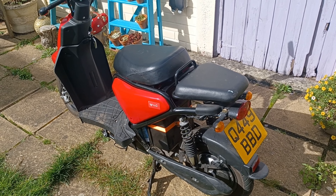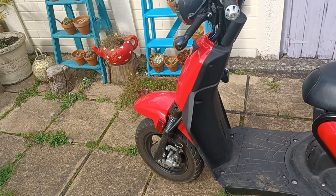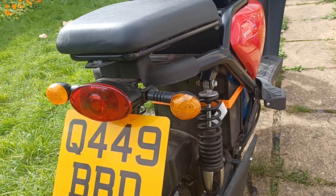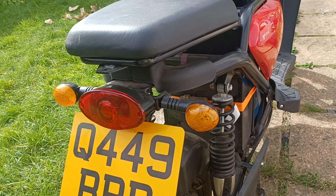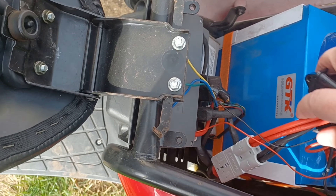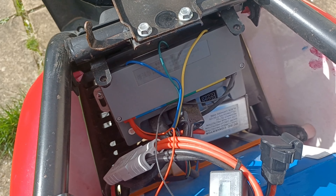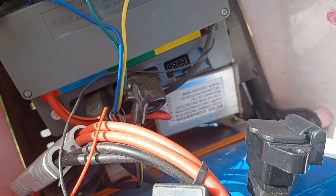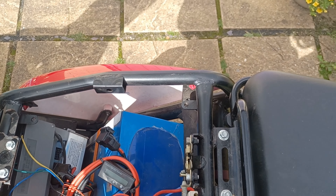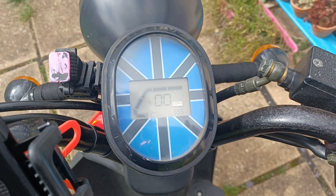This bike is surprisingly capable. To give you an idea on the specs: it is a rear wheel hub motor, 12-inch wheel on the rear and front, disc brake on the front, and a drum brake on the rear — which works really well and will easily lock the rear wheel. It is 72 volts with a lithium iron phosphate prismatic cell battery from GTK Batteries. There's a Votol EM50 brushless motor controller, plus a DC-to-DC 12-volt converter that takes power from the 72-volt battery and outputs 12 volts, so you can use normal motorbike indicators and lights. All the lights are still 12 volts, easy to look after. The odometer reads 555 kilometres total, so we'll see how that looks when we get back.